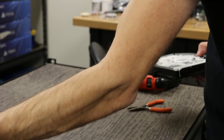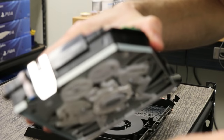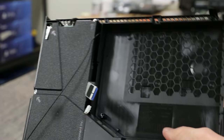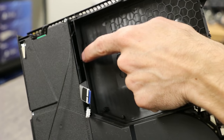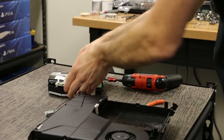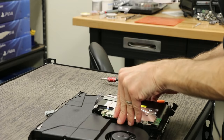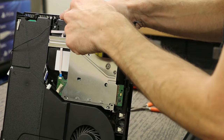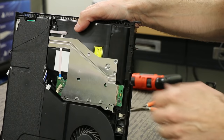Let's get our console back over here. You gotta make sure this metal piece right here needs to go on the outside of this metal carrier on the motherboard — not really a carrier, but a piece of the plastic case. There's a little space between this piece and the power supply — that's where that metal piece goes. Same with the piece that goes right here; there's another metal piece on the optical drive. So we're gonna carefully make sure those are in the correct place on the outside of that plastic piece. There are locating pins here, here, and over here. Once those locating pins are all matched up, it's just gonna snap right in place. If it's not snapping in place, you gotta make sure and check that.